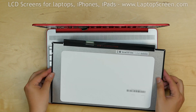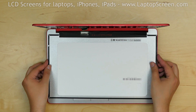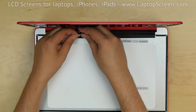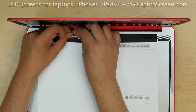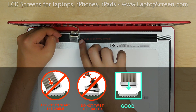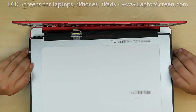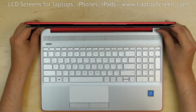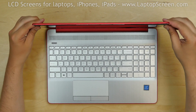At this point, the new screen can be installed. The most important part for the success of the whole replacement process is reconnecting this video connector. Use both hands to slide it straight in — the connector must not be slanted or twisted when plugging it in. Lift the new LCD and align it at the bottom edge, then tack it onto the old bubble gum.